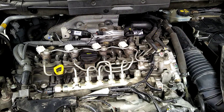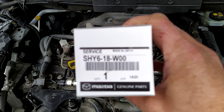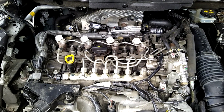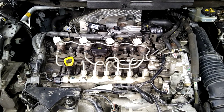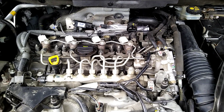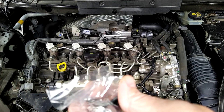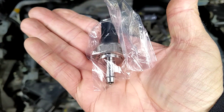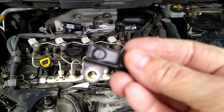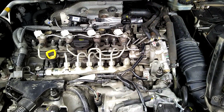To remedy this, you need to get the upgrade for the exhaust pressure sensor. From my research, Mazda has upgraded this part three or four times. I just picked one up and I'm looking forward to installing it. You can see the difference — this is the latest version of the exhaust pressure sensor and this is the old version, which has already been replaced. There has been a recall or upgrade on this three or four times.